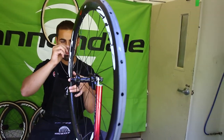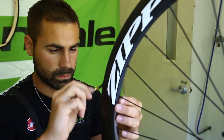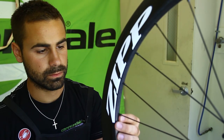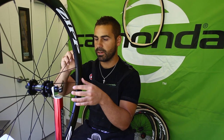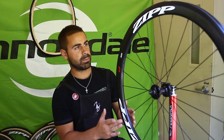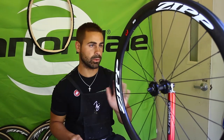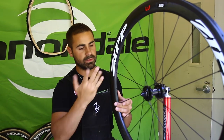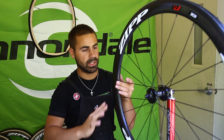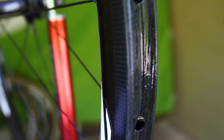When I see tires that roll off, if you look at the rim there are definitely areas where glue is not applied, and that weak spot in the seal is probably what's going to lead to a tire coming off. You want to get from one side to the other and don't leave any gaps, but you also don't want to go over. So as I glue I just take my finger and wipe off any excess glue to make sure the sides are clean and get a good layer on the first side.